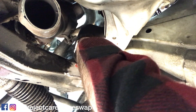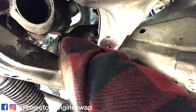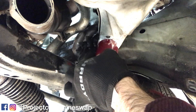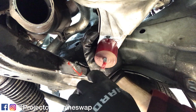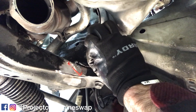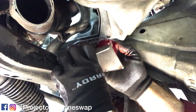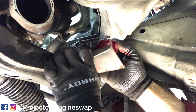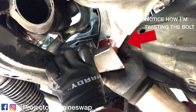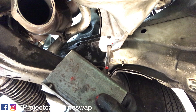I'm going to cover this with red ink and then press it up into position — push it up. I'm holding the screw and putting this where it needs to go, then dropping the bolt. Now I drop this and you can see the red dot is right there — and that is exactly where I'm going to drill.